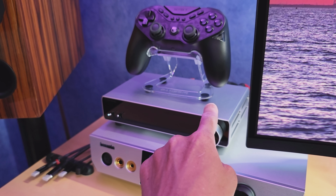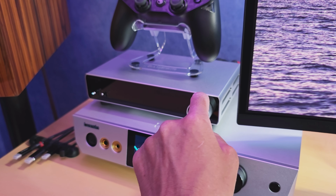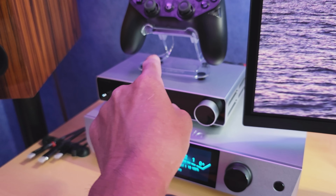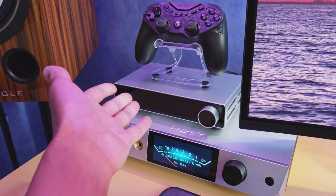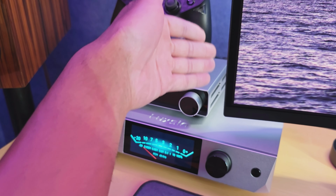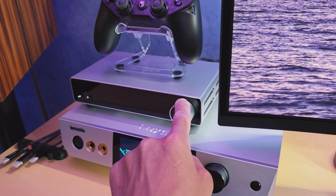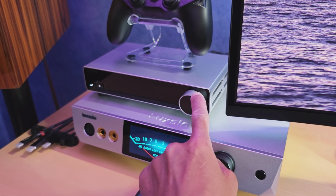Now, I don't know about other amps or other power amps, but on the PA7, when the volume is at max manually, it is exactly the same loudness and sound quality, everything like that, exactly the same as bypass mode. So effectively, you don't really need that switch in the back. You can just whack that up to maximum, and there you go. You have your fixed line level volume input for whatever inputs you've got, RCA or XLR. So yeah, that's an observation to make. And my recommendation is to just take it off bypass mode, don't worry about that, and use maximum volume on here.